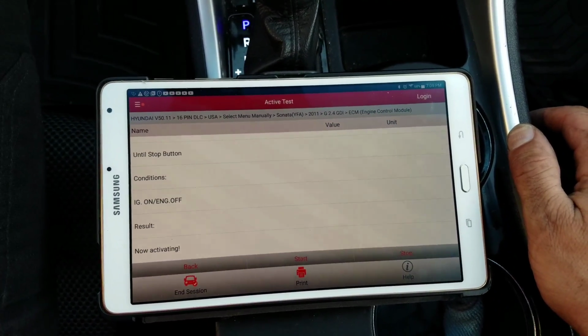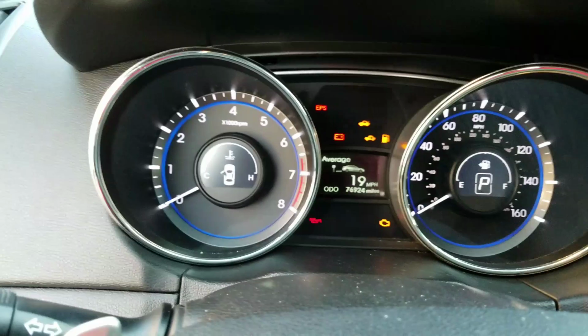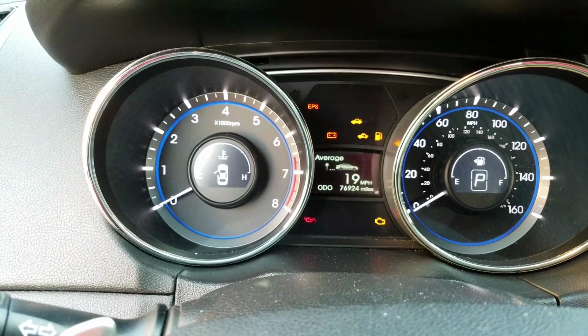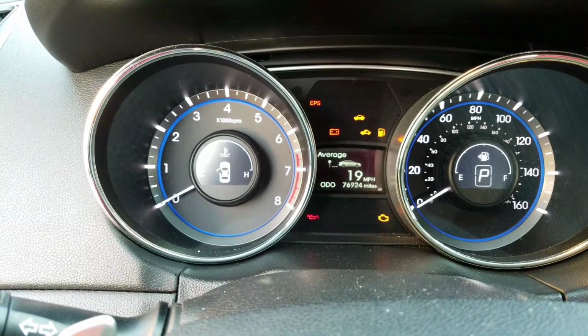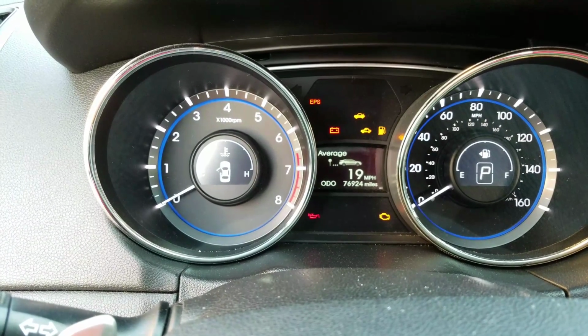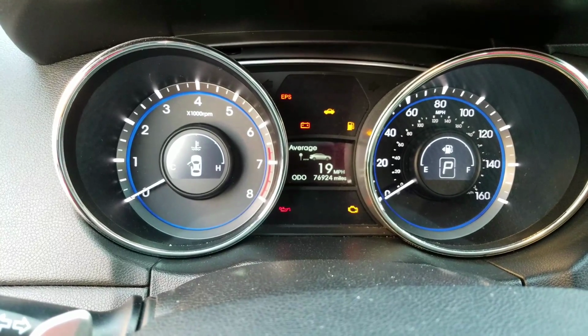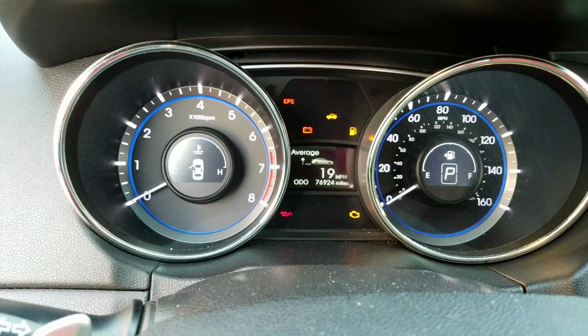And actually sit here and run this through a bidirectional test. Saves a lot of time. However, where you lose the time is with that stupid little amber immobilizer light that, according to factory information, is supposed to turn green if key on, engine off, and a key is being accepted in the vehicle. So, just so nobody else gets slid out there, I'll make a quick video on this just to show you. This car will be getting a fuel pump and hopefully everything will be a-okay.